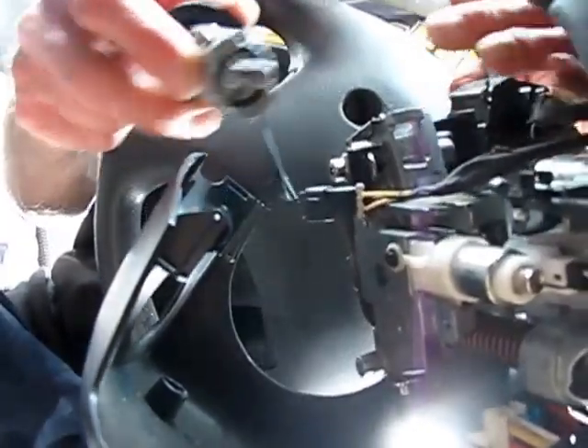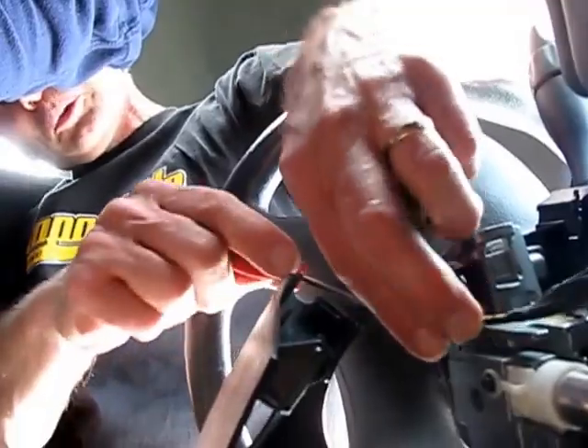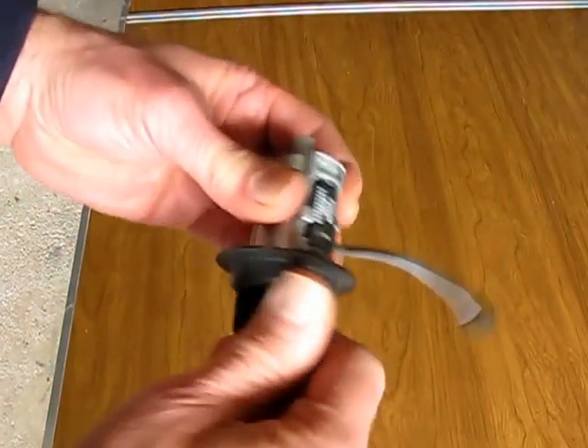You can get in here and see my screwdriver — when you push it in there and pull out, there comes the lock cylinder. This one has an electrical connector on it that you just lift the tab on and pull out.